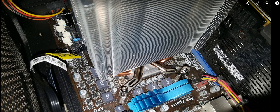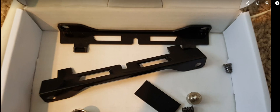The two security screws are a little tricky and take some time — don't rush it. While tightening them, avoid moving the heat sink too much because the thermal paste is already on the CPU. Hold the heat sink steady with your other hand or have someone help you. The screws are spring-loaded and move around a lot, so patience is needed.